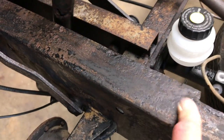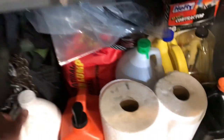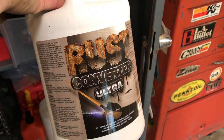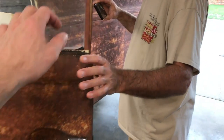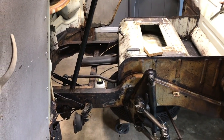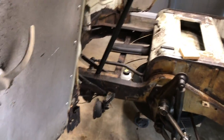The rust converter I use is the add coat — it's the same type of thing, pretty thick. You brush it on. You should put some kind of finish on it because it has a primer but not a complete finish. Even just like that, it'll save this thing from just crumbling to the ground. The other option was to sandblast everything, but this was an easy out.